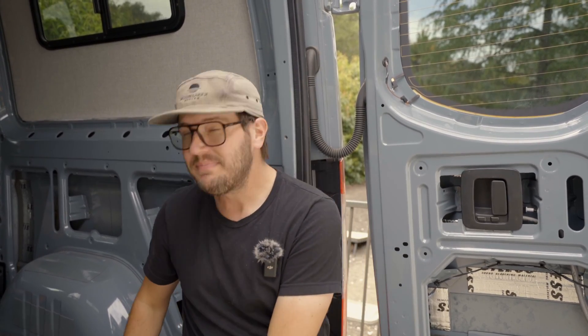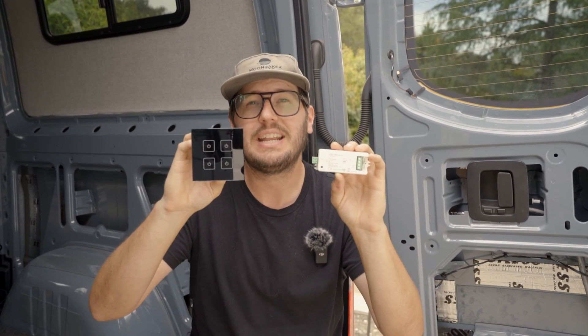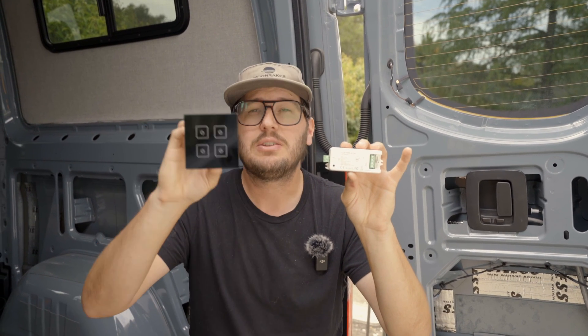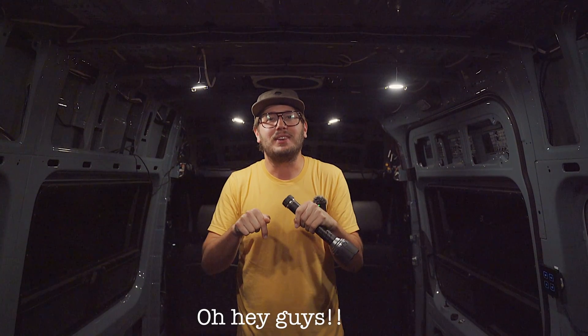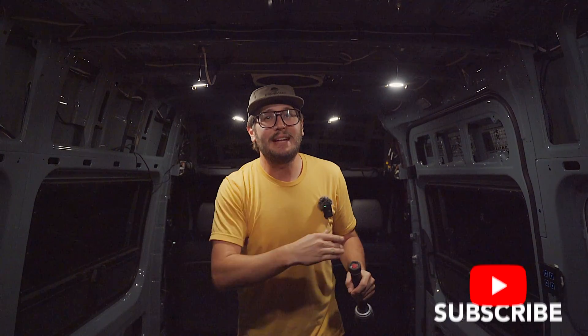Last but certainly not least is the heart and soul of our lighting solution. This is made by a company called Lunacy Lighting. These two components communicate wirelessly to one another. One acts as the switch where you run power in and then power out to your lights. The other controls it. You do have to run a separate circuit here, but it's very low amp draw — only 20 milliamps. It has four distinct zones with dimming functionality built in. It's 256-step dimming, which is super smooth. We're really excited to use this in our van. Are you afraid of the dark? Well, no need to worry because we have our van lights installed now. That wraps up another episode in the Adventure Van Build series. We really hope you enjoyed it. If you like what we are doing, please give us a thumbs up. If you have any questions, drop those comments in the comments section below, and don't forget to slap that subscribe button. We'll see you next time.